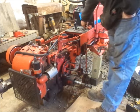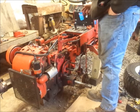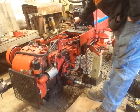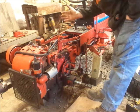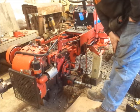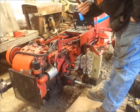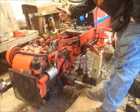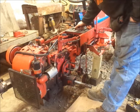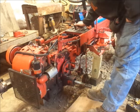There's a couple steps. I read this in a service manual somewhere and I know part of it helps for sure. You want to disengage the PTO just because that heavy spring on there will deflect that shaft and make it a pain to get out. You want to put it in low range because that pulls the detents out of the side cover, along with putting it in second. That's what I've always done. It always seems to work. So, without further ado,